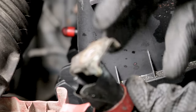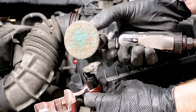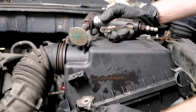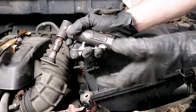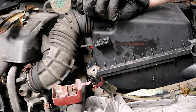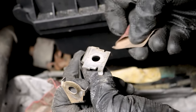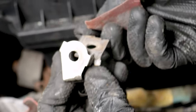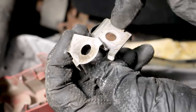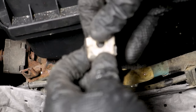Assuming your battery cable looks like this and you want to clean it up as best as possible, they sell tools with a nice little sanding disc on them — very quick and efficient. The problem with air-based tools is they could blow corrosion at you, and if you breathe it in it'll cause respiratory problems. Using sandpaper takes longer but is very effective. As you can tell, I cleaned down both areas — the contact points on the outside and the inside areas where the contact point will be.